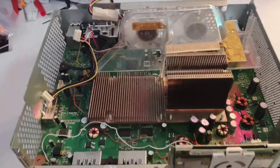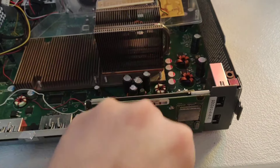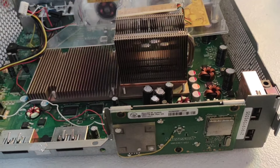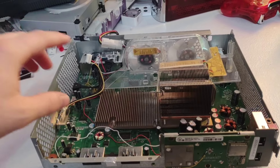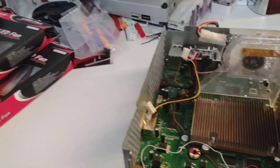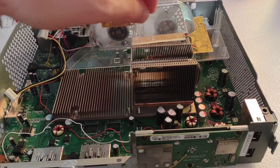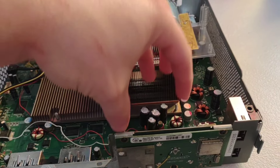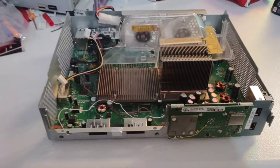First up is this board here with the speaker - we're going to have to de-solder this wire again in order to get the motherboard out. Take this wire, feed it back out of here so this whole thing can come up since it goes through that hole down there. We're just going to put some regular heat sinks on here - I've got heat sinks laying all over the place, I'm probably just going to put two copper ones on there. I kind of want to use one of the blue fans on this build, so we're not just taking this out - we're also planning ahead for the Yoda build.